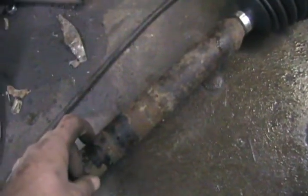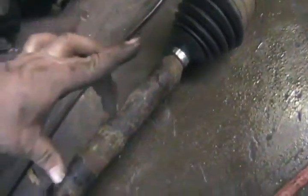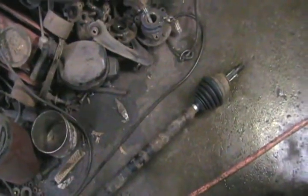I did the same thing but opposite — I machined a solid plug that went inside the axle, different diameter on each end, then pressed both pieces together, welded it all the way around, and balanced it while I was welding it. I did all that nine years ago and never knew if it was going to last, because I'd never welded front-wheel-drive axles together before. But being that this motor only has about 74 horsepower, it's not a whole lot. I wouldn't try this with a high-performance turbo car, at least not with how I did it.